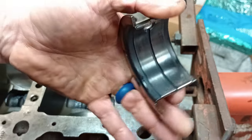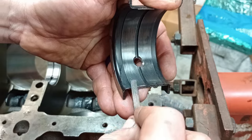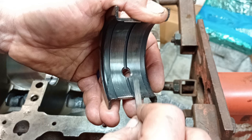Same on the other side, then flip around and do this side here too. Where the little bearing tang is, it's a little more difficult. You need to do the upper shell the same way you do the lower shell. Bearings are made eccentric — all rods and mains are made eccentric. At the parting line they're bigger, there's more clearance there — they're lemon-shaped, if you will.